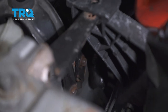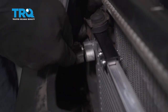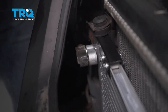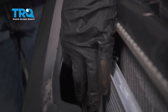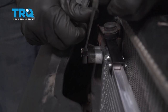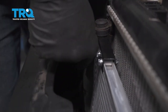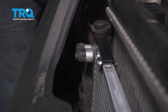This side is nice and snug. I'm going to do the exact same thing on the other side. Let's reconnect our AC lines — I'm just going to line this up and press it in. It should go in fairly easily, assuming you added that PAG oil as lubricant. We'll start the bolt in there, and once it's started in by hand, go ahead and snug it right up. Right there it feels as though it's bottomed out — we're going to tighten this a little bit more, keeping in mind that it is only aluminum that we're tightening into. Grab that line, make sure it's fully secured, and then go ahead and make your way underneath the passenger side front of the vehicle.